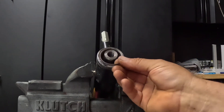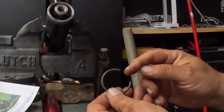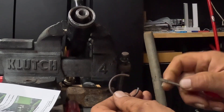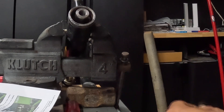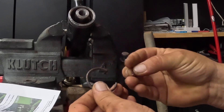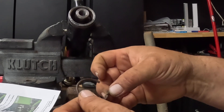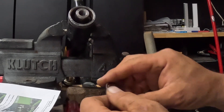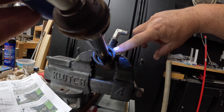In case you have the same problem I had: the snap ring was rusted in place and could not move even though I used penetrating oil. What I had done was drill a hole right where the split is on the snap ring — the hole should have been over on the side of the ring so that you can push on it from the outside with a screwdriver. Because I couldn't move the snap ring around I had to drill another hole, and unintentionally drilled right on the edge of the ring, which caused it to break off. Whatever you do, don't put the hole in the split on the snap ring.